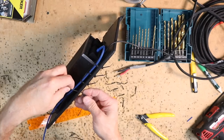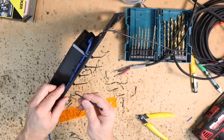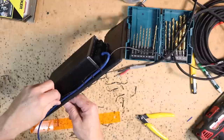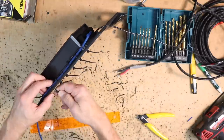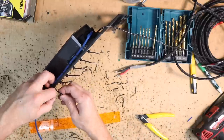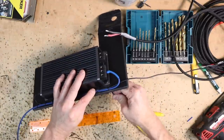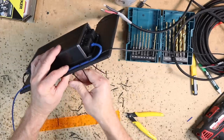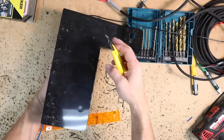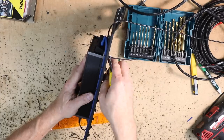For aesthetic purposes, try to have all the heads go the same direction — for two reasons: one, it looks cool, but two, depending on how you're wiring it up, you may have multiple holes next to one another, and the head doesn't cover the hole you may need for the next run. Pull your wire to the appropriate stress-free length on both ends, pinch it in place, and pull the zip ties tight. Make sure the wires don't cross each other — you want them to run flat on top of the board. Make sure when cutting off your zip tie heads, you use a flush cutter and cut as close to the head as possible so you won't create a razor blade to cut yourself with.